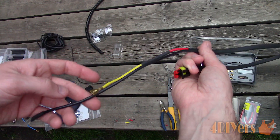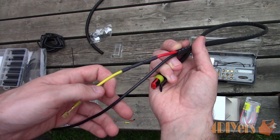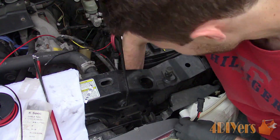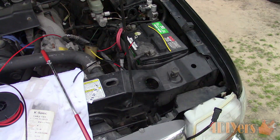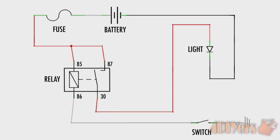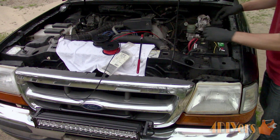The relay pigtail was added — this goes onto the switching side of the relay, receives power from the fuse box, and the black wire has an eye terminal that connects to the body ground. Time for installing this wire: it runs behind the grill, around the plastic diffuser, behind the headlight, through the bulb cutout in the front end frame, in front of the battery, along the main harness, and to the fuse box location. A little test to ensure everything is working correctly — I've grounded out the coil side, as the relay has a constant power.